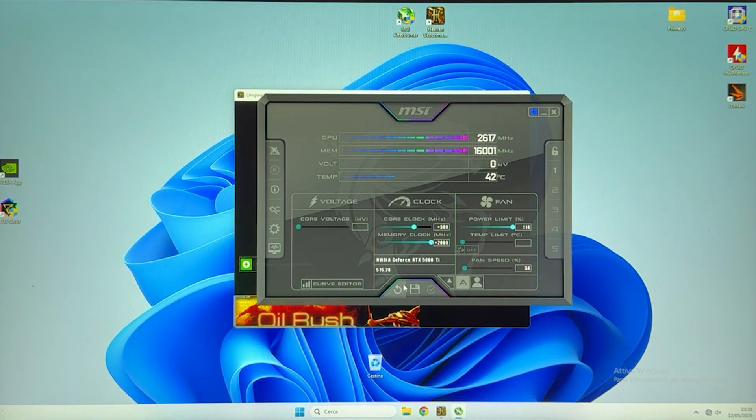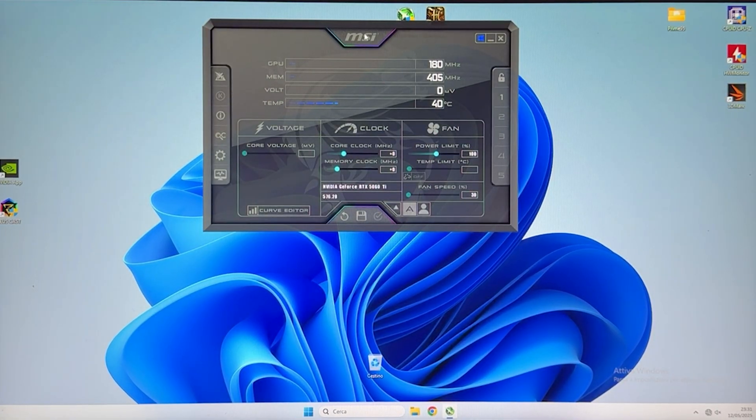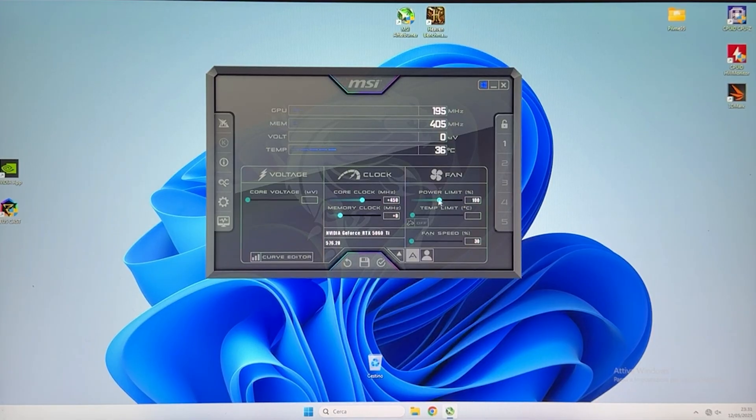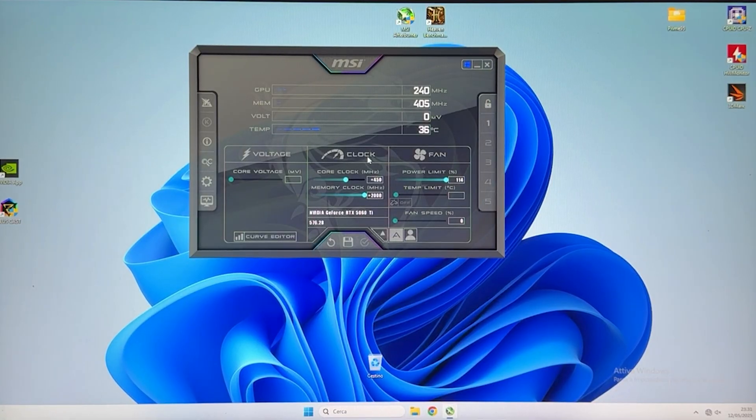If you do crash, don't worry about it. Your screen may go black but it's going to eventually come back, and even if it doesn't you can just turn off the PC. Hit reset in Afterburner, and after a crash I recommend rebooting before getting back into testing — you don't want to keep testing after crashing as it may alter your values. This card specifically tops out at +450 with an unlocked power limit and 2000 MHz on the memory clock. However, if it were my daily driver I would run it at around +350 to be extra sure everything is stable.